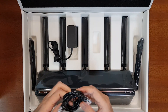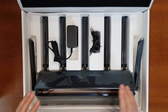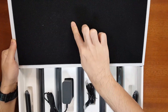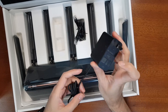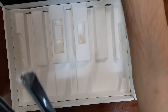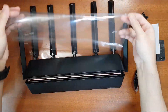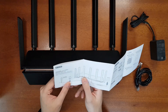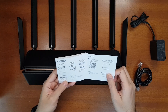The contents include an Ethernet cable, and the packing is the same as the AX3600. The form factor appears to be exactly the same — it has six external antennas and one AIoT antenna. The box has padding for protection. There's a power adapter at 12V 2A and a user manual, which is a quick setup guide in Chinese. You connect the Ethernet cable to the WAN port, then power on, and use the miwifi.com web interface or the Mi Wi-Fi app.